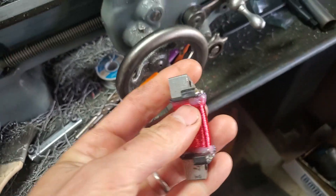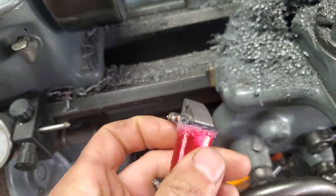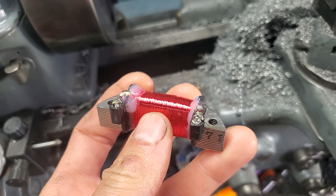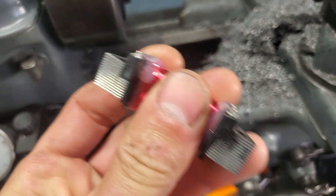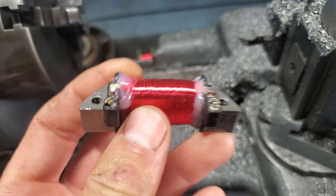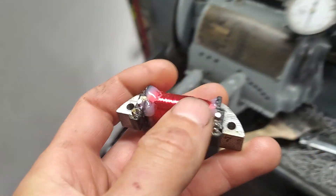I rewound it again and then it broke at three quarters — and it's always fun removing that much wire. This was last night. I finally managed to get my third one rewound. This one's about 10 ohms short of the minimum. The minimum is like 385 and this is like 380, so it's fine. It's pretty cold out so it might go up, but it's good. The ohms are just a general guide — you just have to be very close or within the spec; you don't have to be exactly on the number. This one's producing around 380 ohms.